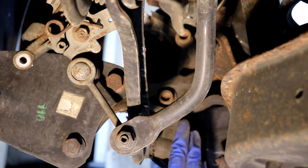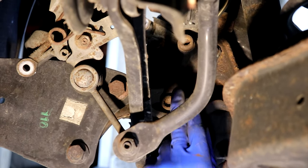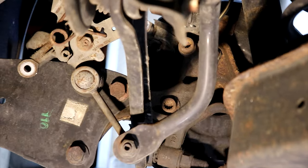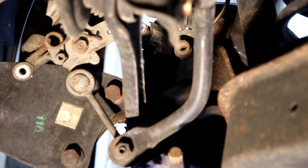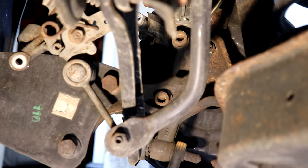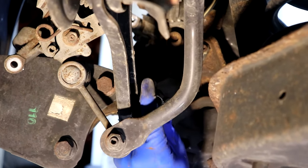So the plan is these have a little bit of wear, so we're just going to do a light cleanup on those rotors and scuff the pads to get a new fresh surface. Now we're on the backside. The front uses a 21 millimeter, but in the back it uses a triple square — the bit that looks like this. It's a size 14; some people call it an XZN, some people call it a triple square.